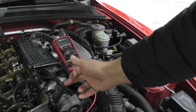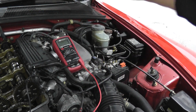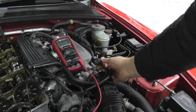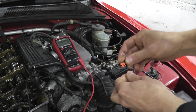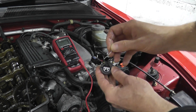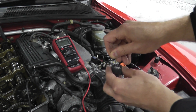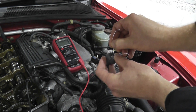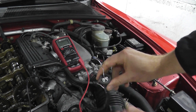The first thing you want to do is verify that you do not have a wiring issue. The sensor can be perfectly fine, but maybe you have a problem with the wiring or even a problem with the vehicle's computer. So I turned off the ignition key, removed the key, and now I'm just removing the harness connector from the sensor. You have three terminals. What you want to do is just grab a paper clip, cut it in half, and I'm placing the first paper clip in terminal number one, then another paper clip in terminal number two. You can purchase something called a jumper wire, but this works perfectly fine.